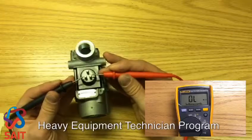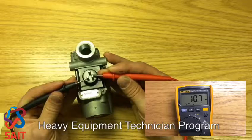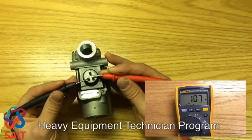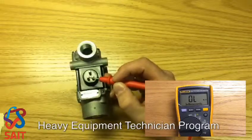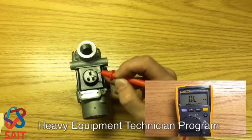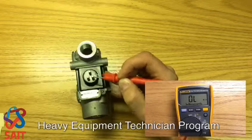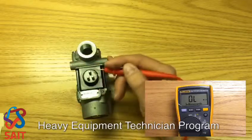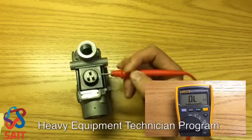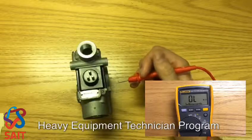If I take a connection from this pin to this pin, what we notice is that the resistance values add together and we get 10.7 ohms. The reason for this is that we actually have an inlet and then a common ground, an exhaust and a common ground. So we actually have the two solenoids being operated on one connector with a common dedicated ground that goes back to the ECM. This is what allows our ECM to self-diagnose when the solenoid coils are not operating as they should.